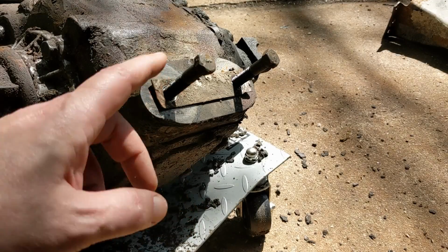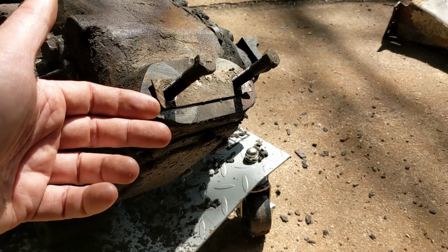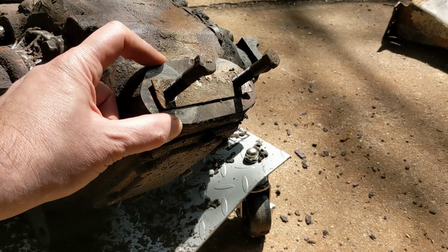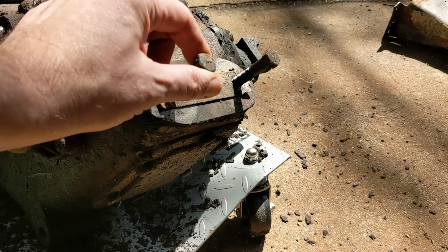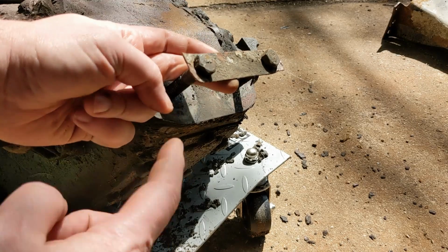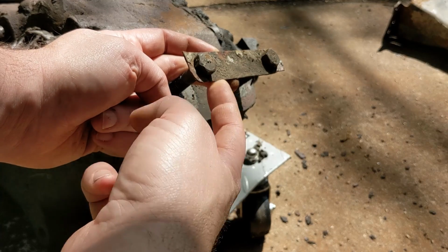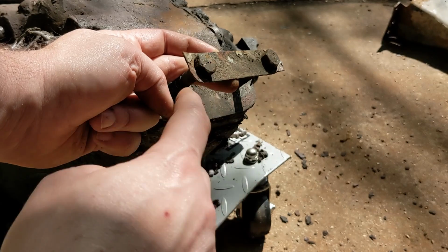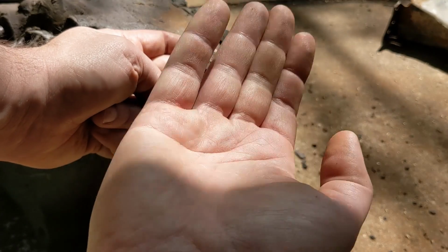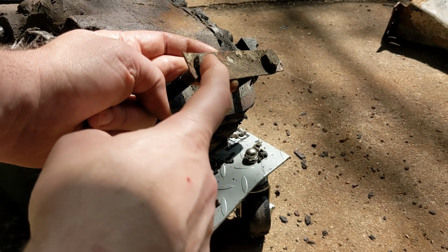One quick afterthought on this. If you're trying to pull this transfer case out and leave the cross member in, let's say you want to repair or replace the bushings that go in here, there's a rubber bushing that sits below the cross member and one that sits above, and then this bolt goes through. Well, this tab is on here, and then one of these ears is folded over on each side so that you can't get to it. This is a steel tab. I had to fold these corners back with a chisel from above. This is sitting right underneath the cab. I don't know how you would get to that to fold that over in order to get a wrench on it.